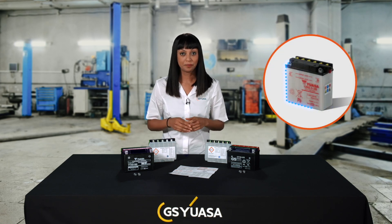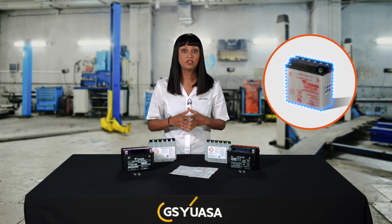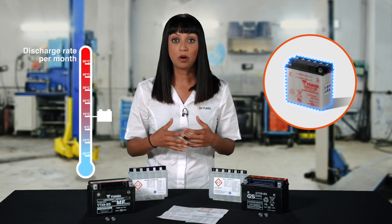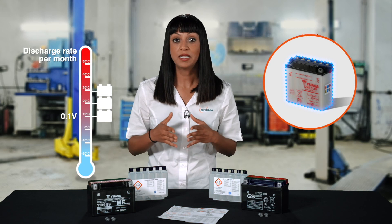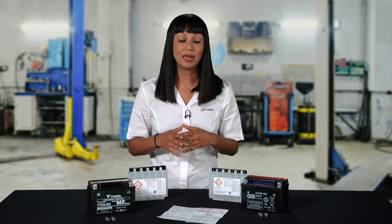Once fully commissioned, the constant chemical reaction within the battery has been started and cannot be stopped. This means that the battery is now continuously releasing electrical energy and self-discharging. When in service, the self-discharge rate is dependent on temperature and the number of permanent electrical consumers on the motorcycle. When disconnected and at 10 degrees C, a battery self-discharges at approximately 0.1 volts per month. This rate doubles with every 10 degrees C temperature rise. When left connected, the extra electrical demands of the motorcycle consumers increases the discharge rate significantly.